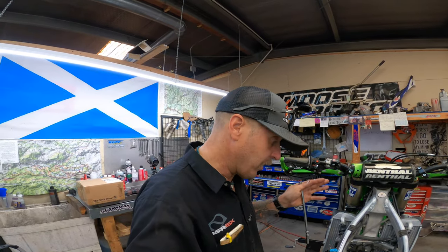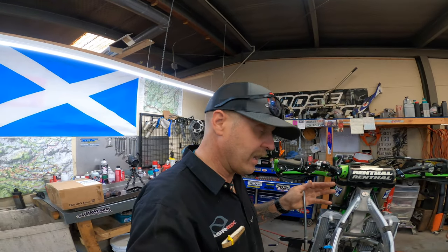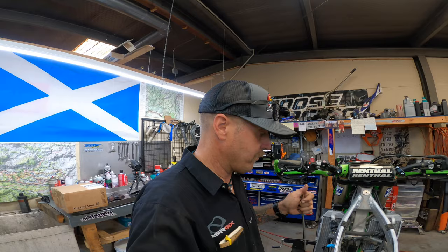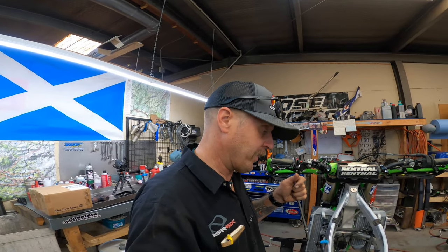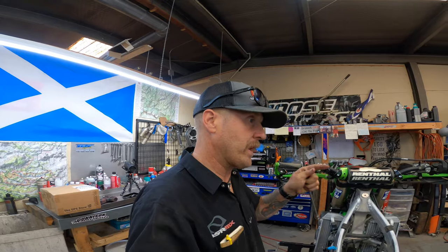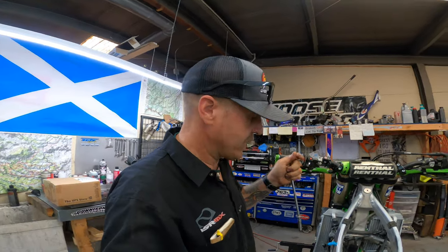So now we're gonna set these to 7 foot-pounds. That's all you do. Otherwise, you will ruin the head of a motorcycle. So if you don't have a torque wrench, get one if you're gonna do this job. I really do like the nice digital ones, just because you get better feel with them. You can be more precise. The clicky ones are fine, but just make sure you get one that's rated for the right kind of range of torque. And 7 foot-pounds is not a lot.